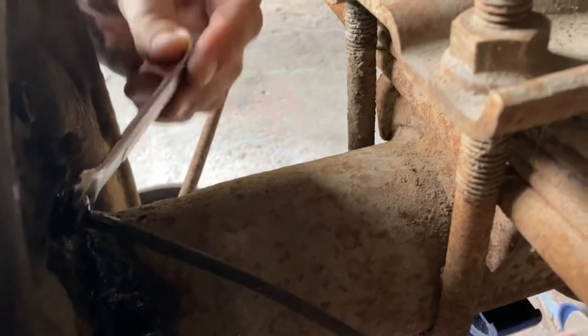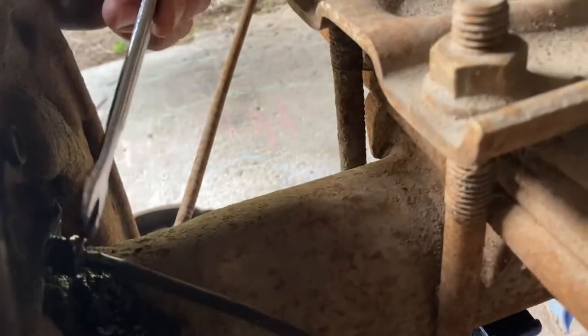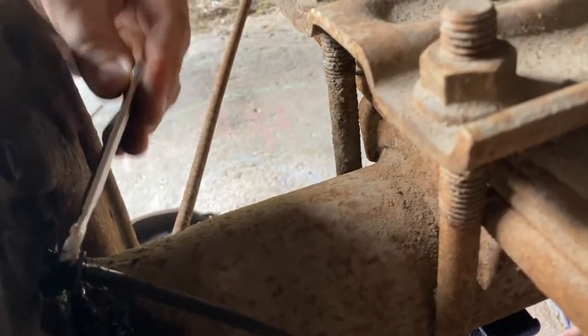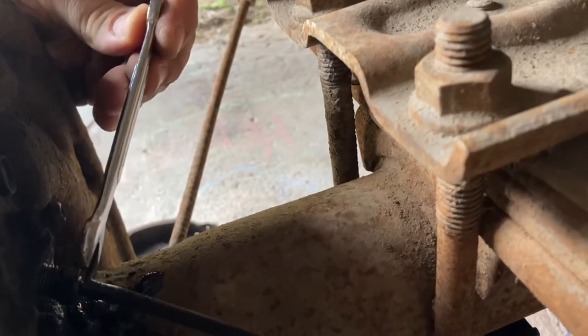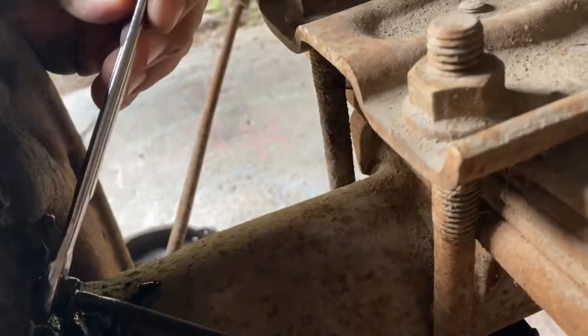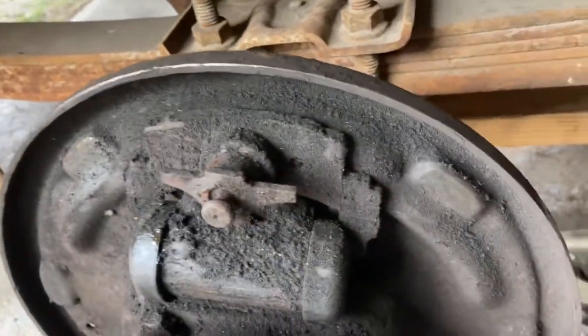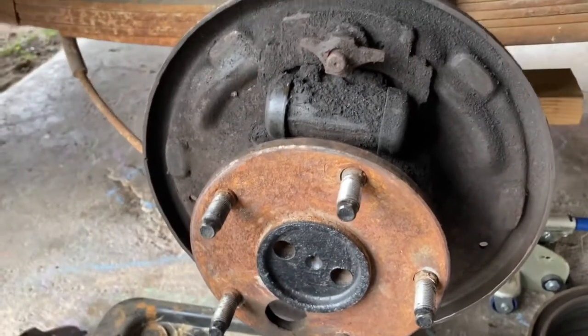Just a few turns and this should pop right out. I was also looking at where the leak is on my hub. This one wasn't leaking, but the rear right was. We're determining whether it's the wheel cylinder that just needs tightening, or perhaps the axle seal inside. There's no buildup on the bottom — everything is right in this area — so it's probably a combination of just an old wheel cylinder leaking over time. The rear brakes, with these things falling apart, weren't very good.